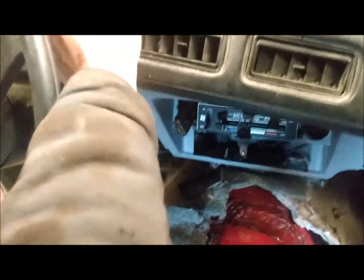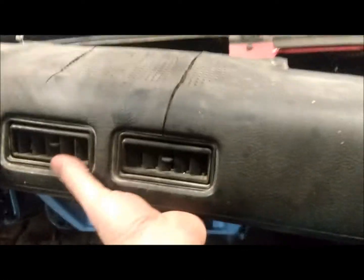You just lift it up and then pull it out of the slots in the back and pull out the other side. You want to do it evenly — I'm not doing this very carefully as this one's got a couple cracks in it. Of course the radio will have the speaker cable connected. You will want to either disconnect the radio and make sure that wire travels up and out with you, or disconnect it here by pulling the tab and sliding it out. Don't cut your hand in there — things are sharp.